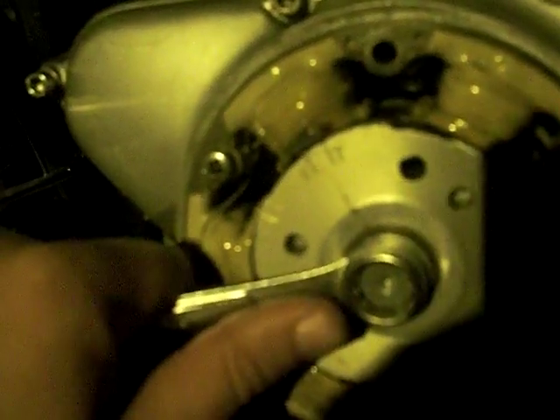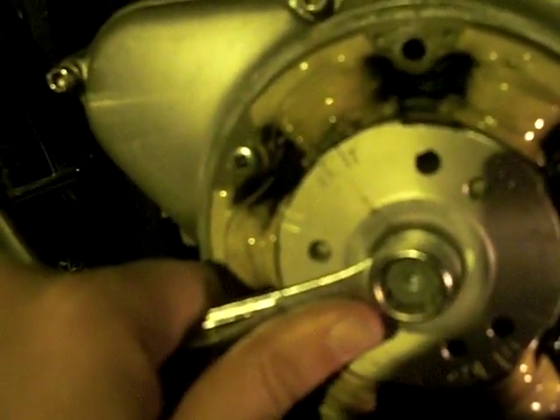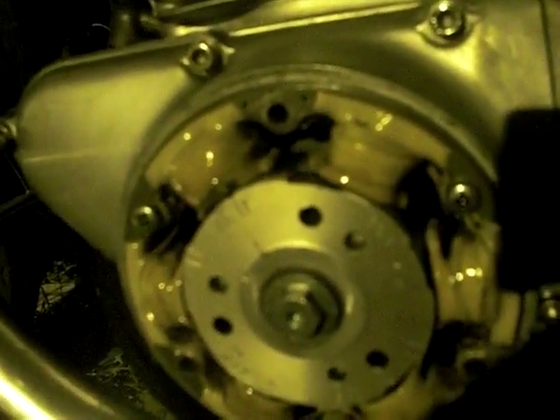We're gonna spin and here's the F mark and the index pointer — and we are a little late. So we're right lined up here and we're a little late. So fortunately, since left is early and right is late,